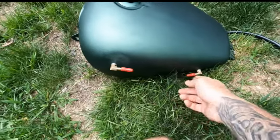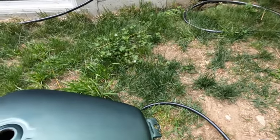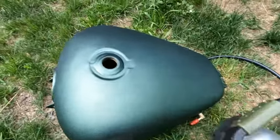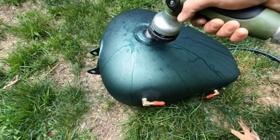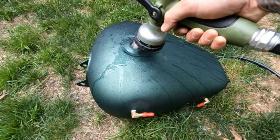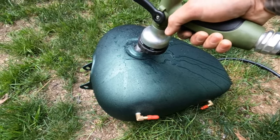We've got our ports plugged off. This first step — now that the tank's been dried out, I left it in the sun. Obviously dispose of your chemicals or gas properly. The price of fuel these days, you're probably going to want to just use your fuel again. All I'm doing right now is a rinse cycle — rinse this out completely, shake it around. Then we're going to put in the cleaner degreaser, which is the degreaser and some warm water. It's like a half-hour process after this.